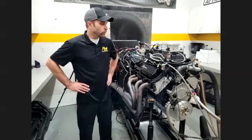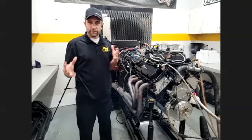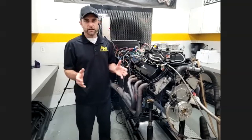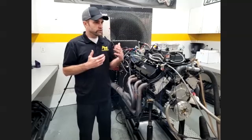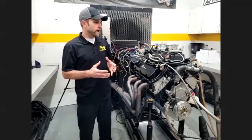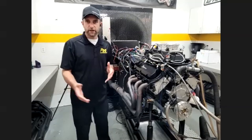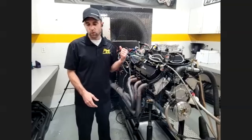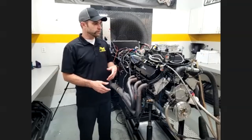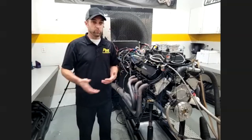The engine dyno gives you the ability to fine-tune that combination versus being on a chassis dyno. Not that you can't tune on a chassis dyno — it's a great tool as well — but for steady-state testing only certain chassis dynos will allow you to do that. We could actually purposely put this engine into detonation to know what is the peak amount of timing we can run. Your throttle handle can be pulled back almost immediately, whereas on most chassis dynos you've got to make a whole run, so if you add a degree or two of timing, you won't know it's too much until the pull is complete.